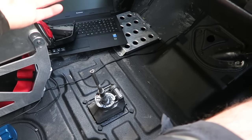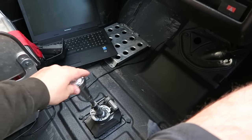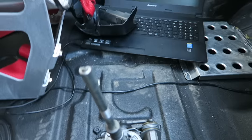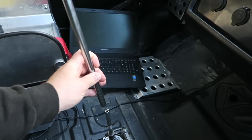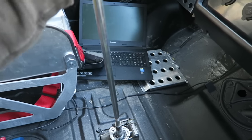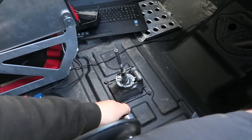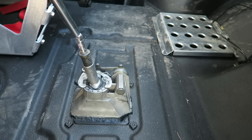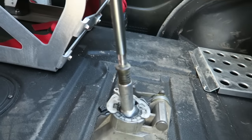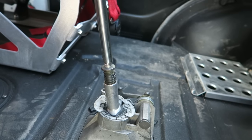I've got the Audi TT or Golf Mark 5 shifter in here at the moment. It does feel lovely to shift with, but the only problem is it's quite a reach. So what I'm going to do is cut the stick down. I've got a sleeve here which is a 12mm internal diameter with a 15mm outer, and that slides down over the top to relocate the gear knob to about here, just in line with the handbrake and the hydro. I'm going to chop this down to two inches so we've got the ability to sleeve either side.